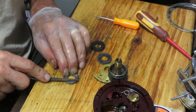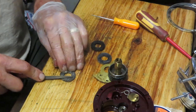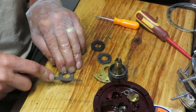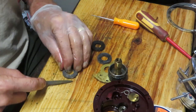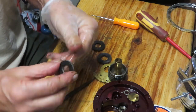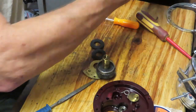As I mentioned, this is asbestos. It's a very heavy and hard material. So let's keep it flat to the washer. You don't want to remove the material, but you do want to remove the old greases or whatever might be on there. That is important. All right, that's washer number one. You can put a light coat of grease on it, but it's not going to absorb it, so you don't have to go crazy with the greases.